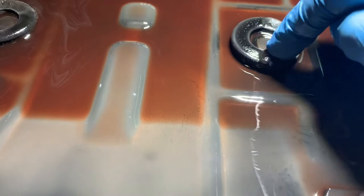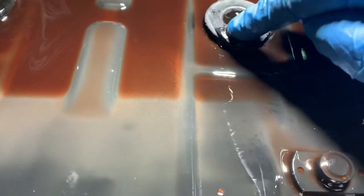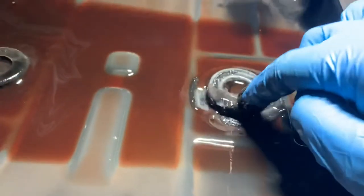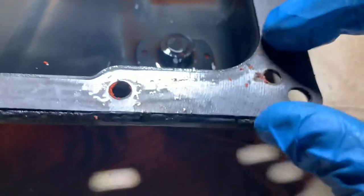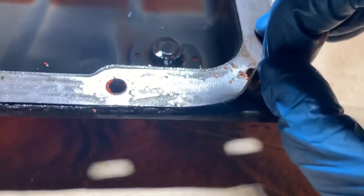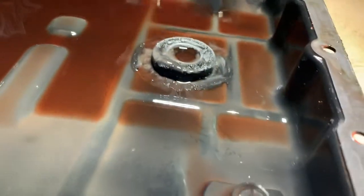Here's the bottom of the drain pan. There are two magnets here that pick up any metallic debris. There's a little bit of stuff on there, but nothing indicating gears or anything wearing out — the transmission has been shifting well. Some magnets are also on the drain plug. We're going to clean this up and replace the gasket. The new gasket comes with the filter when you buy it, so we'll scrape the old one off and replace it.